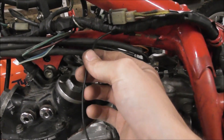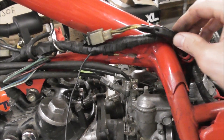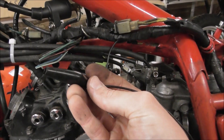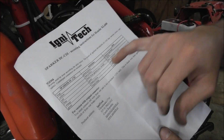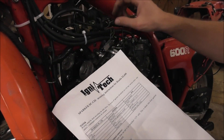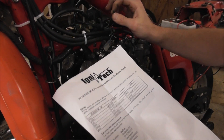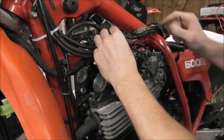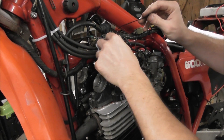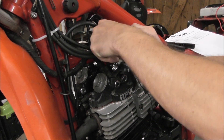You also have to take a key-switched 12V from the battery for this CDI. They have a description of what wire to use — it's a black wire from back here somewhere, and I already connected it, so this is my 12V for the CDI. The description says to connect green-yellow (sensor crown) to blue, but what I have is green-white — I measured it and it's from the sensor, so that's the right one. The black-red wire originally came from the ignition coil, but since we don't need the ignition coil anymore, we don't need that wire either — just secure it so it's not messing around.